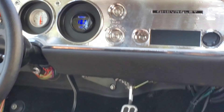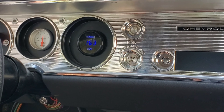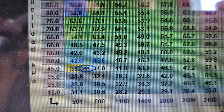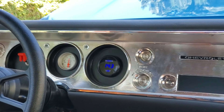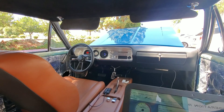As you can see, we're running about 16 to 17 to 1 air fuel ratio. That's pretty darn lean, so we're gonna try to add some fuel. I just added some fuel to those cells — they were around 28, I bumped them up to 35 and 34. And as you can see already, the air fuel ratio is at 14.3. The idle smoothed out pretty good.